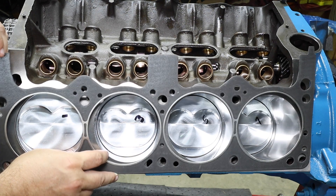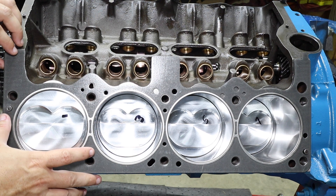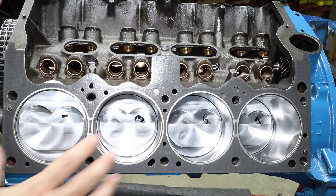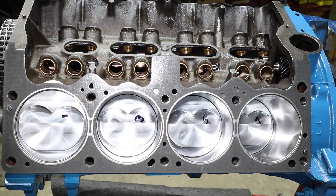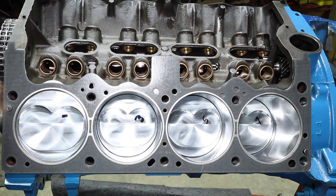I made a dummy statement saying make sure that no ports are covered, but obviously you can't get away with that. These gaskets are also designed for use with aluminum heads, which is exactly what's going on here. So anytime you change up the heads and you're going from an iron head to an aluminum head, you want to make sure that you change out the gaskets.